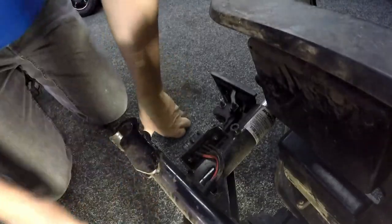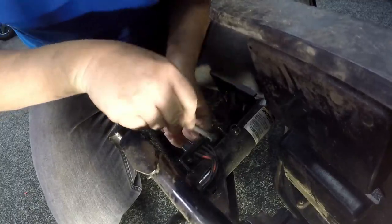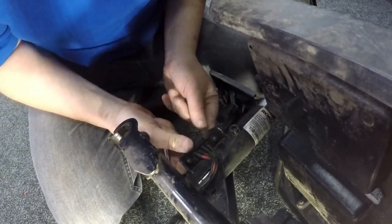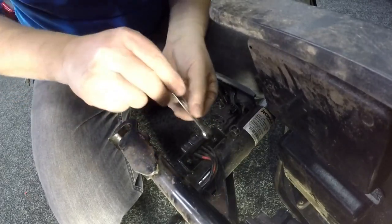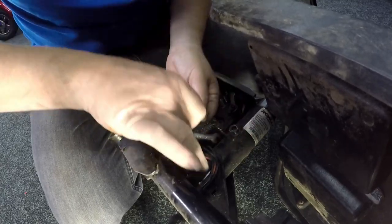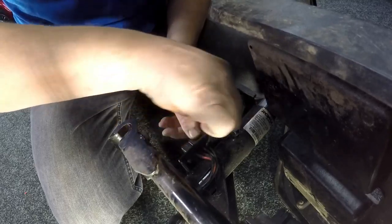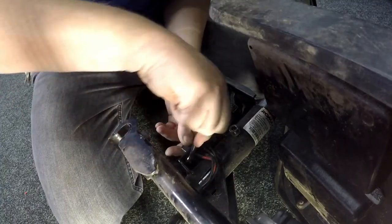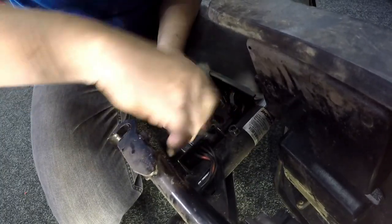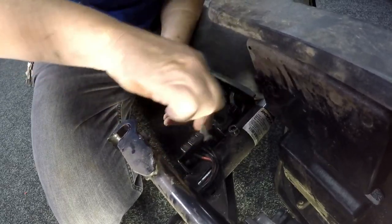I've removed the wires from the controller, taken pictures, and I'm undoing these screws. When you put it back together, don't tighten it fully right away because the connector needs to be able to move and line up with the other side. Put the screws on tight enough that you can still adjust it, then once it's joined to the back, align it nicely, tighten it, and try it again. If you tighten it straight away it may be misaligned — there's quite a lot of movement in here, and if it's not aligned properly you'll jam or break it when you close it.